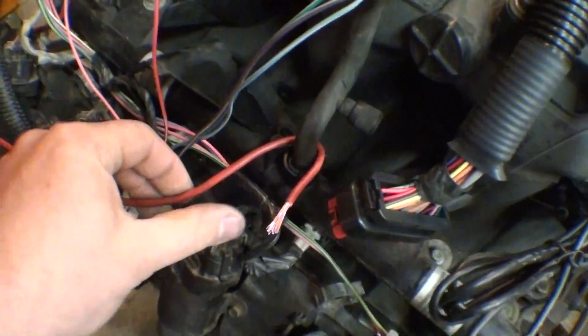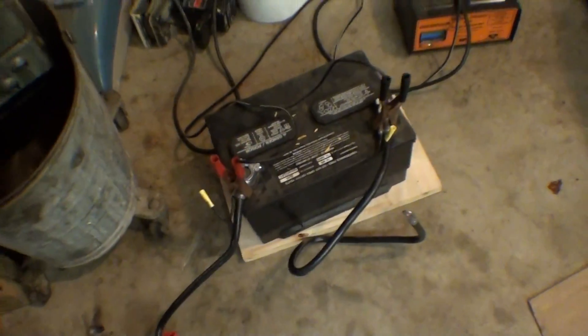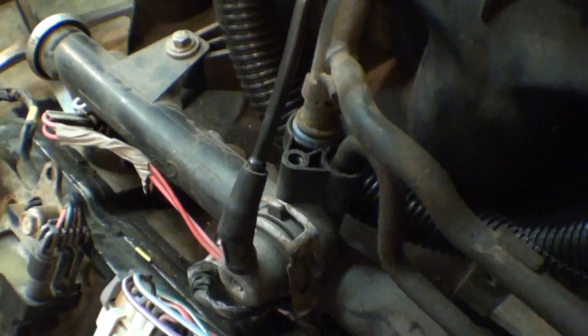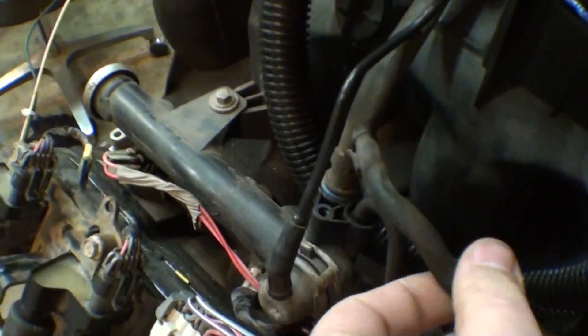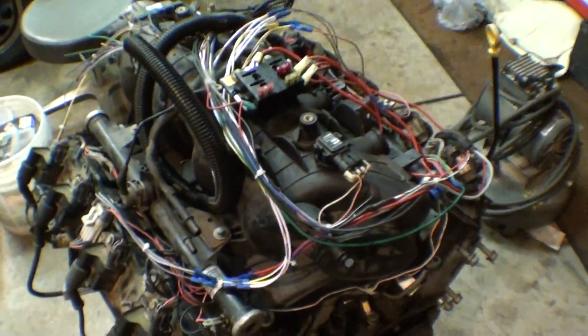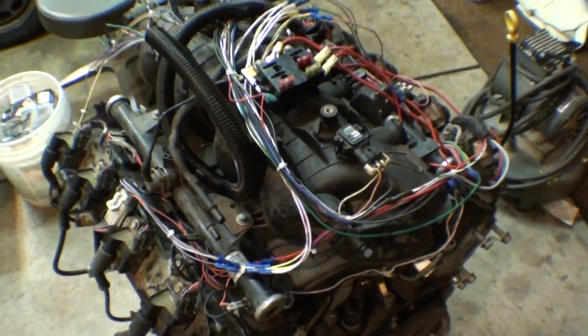And then I just have a thick power wire on here. I can just touch that and then wire up to this battery here and hit it off the starter. The only thing I'm waiting on is this fuel rail is foobarred on this thing and it's missing some fittings. So I got to get a replacement part for that so that we can pump some fuel through it. I might use like a little coolant reservoir to pump the fuel in and return it — like a half gallon or something.